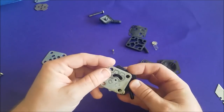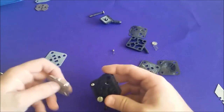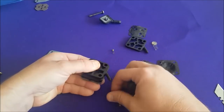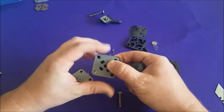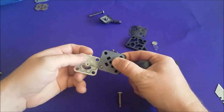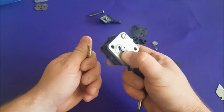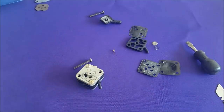When you put this top back on, notice that little notch. The little outlet plate here also has that little notch — those two need to line up. If they don't, you put your little intake on the wrong side. Fuel comes in through here, so if it's not over on this side, it probably ain't going to be sucking the gas in. So there's the gasket — nothing's moved so far. There's our little notch, there's our U — line those up. Looks like so. Put our screws back in. And there's basically our rebuilt pump.